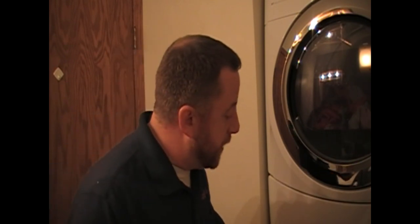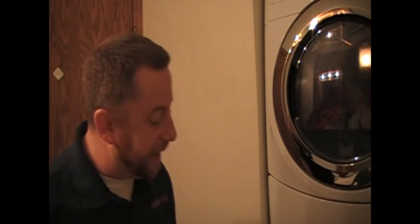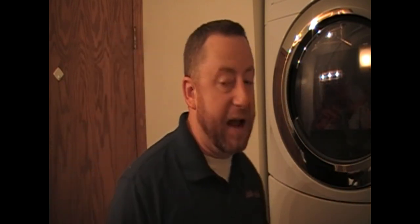After we're done with that, we're going to run it again. Do this like three or four times with that dishwasher detergent, and you'll notice the black stuff is going to start fading away. If you're noticing it's not fading, it might take more — it might take six to eight washes to get rid of all of that stuff.